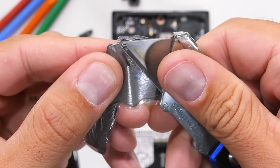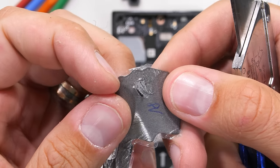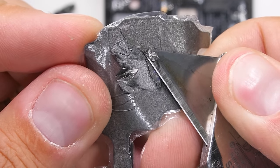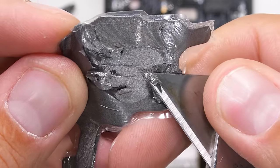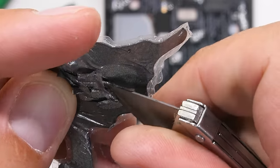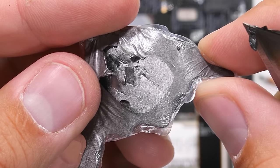It's hard to believe that there is no copper in here for heat dissipation. I can peel up the gray pad underneath the motherboard — slicing it open, it looks like just a bunch of thick, flaky graphite that we've seen as secondary thermal layers in other phones. But it's used as the primary thermal conductor here, without thermal paste. If this was a $400 phone I'd be just fine, but this phone is an insane $1,300.